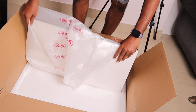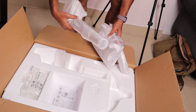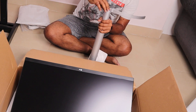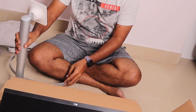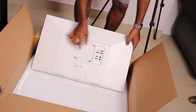The whole package is covered with strong, sturdy thermocol so it won't be affected in transit. First, assemble the stand. It comes in two parts: the arc stand that sits on the desk as the base, and the arm stand that holds the monitor. Just tighten the screw at the bottom of the arc stand, position the monitor correctly, and you'll hear a clip sound when it perfectly aligns. The VESA mount is also compatible with 100x100 arm stands.